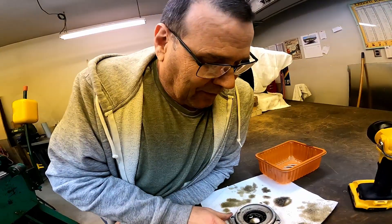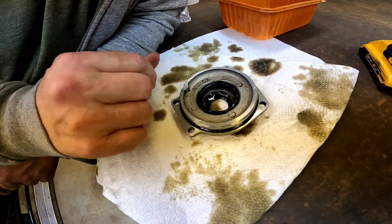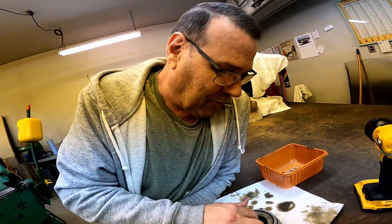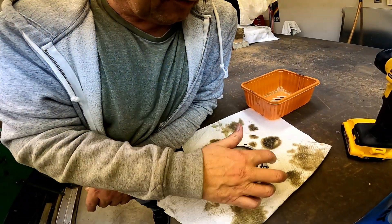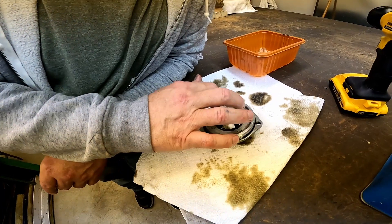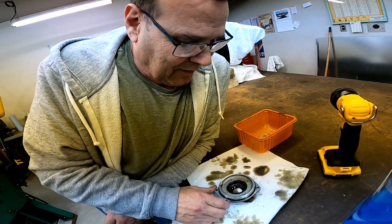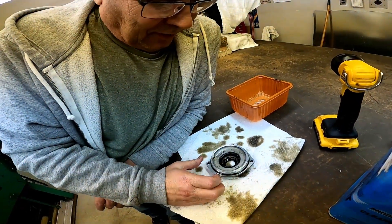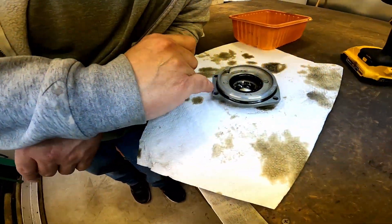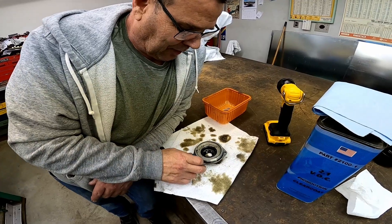What we're going to do about it is clean this all up. We have new seals and a new o-ring. We're going to clean out the crank stub where the spline is for the drive shaft, clean it up really good, clean all these surfaces up really well. Put a new o-ring in, put two new seals in — a little bit of Loctite 271 around the exterior, press them in back to back tight, get everything good and dry in there. Lube her up with some 2-4C between the lips and some two-stroke oil around the outside. Then reinstall. Have a look at these flanges, make sure everything's flat, not twisted or bent or torqued. Have a quick look at the bottom and then reinstall her.